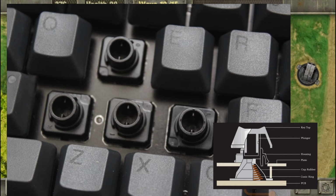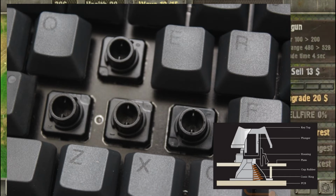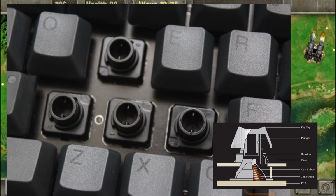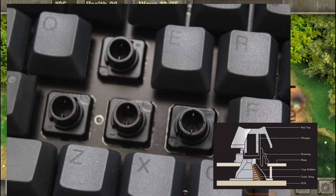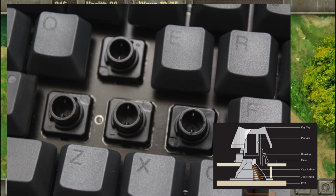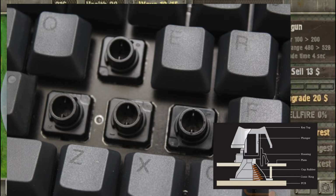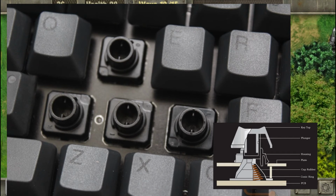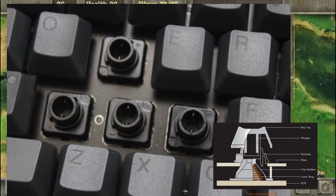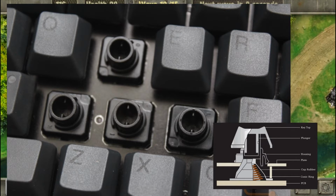When you press a key on a Topre switch, it depresses a rubber insert which flattens a conical spring, which touches its relevant contact and creates some change in some complicated sciencey thing that ends up in a final actuation. They can require anywhere from 30 to 50 centinewtons to actuate. They have a travel distance of around 4 millimeters, though some people find them way too similar to rubber domes. They have an insanely smooth travel, but are also really pricey.